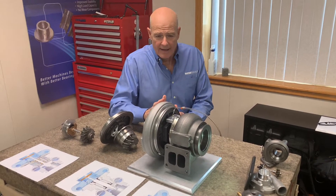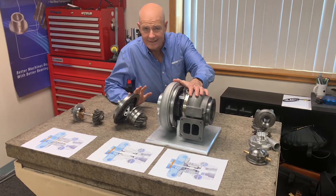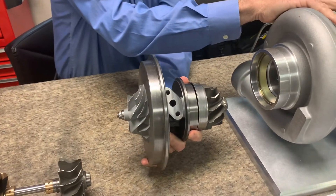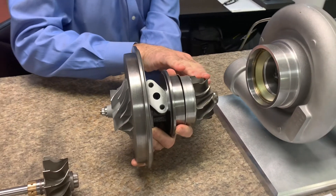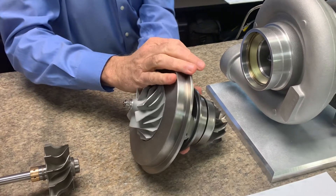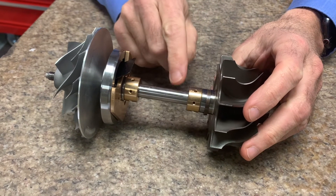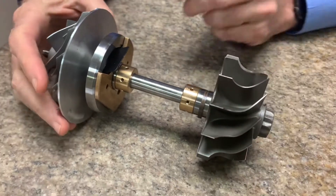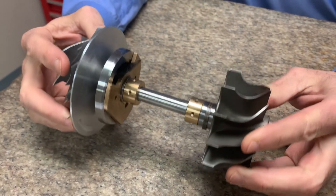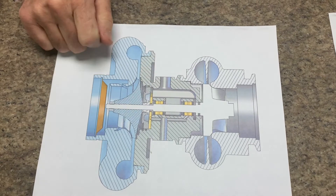Let's look into the guts of this turbocharger the way it is now on oil bearings. This is the bit that's inside all of these case castings. You can see the compressor wheel, the turbine wheel, the input port for the oil and the exit. Looking at the actual bearings, you can see the oil comes in through these little holes and runs between the shaft and the bearing. This is the thrust bearing assembly — what keeps the assembly axially constrained. We've got a cross-section showing two radial bearings and the thrust bearings on the compressor side.